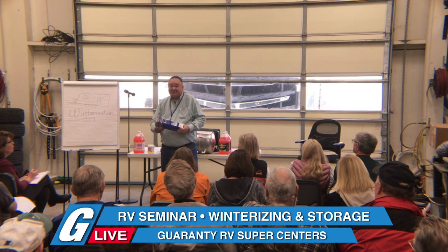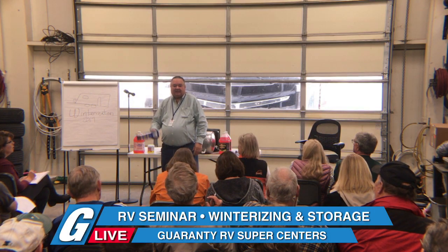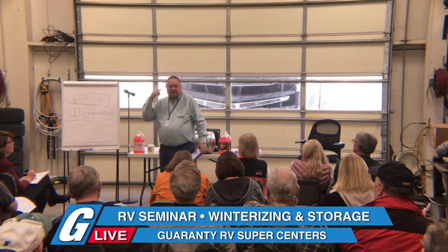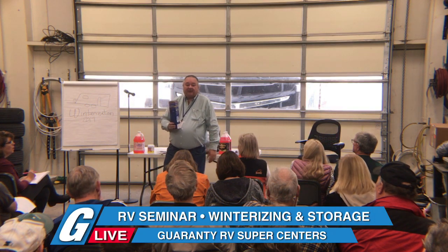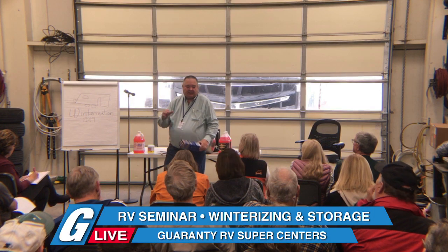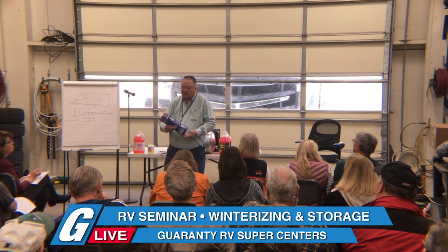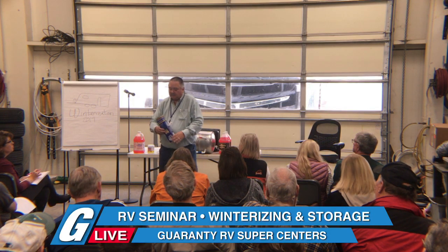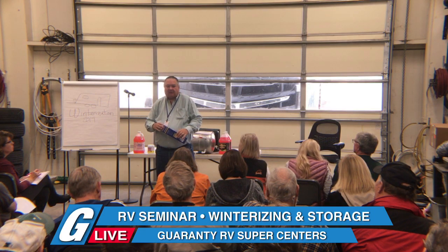Because all you're going to do is get sludge. So in the fall, you take this thing out, you pitch it, and then in the spring, when you get ready to go again, put a new filter in. So the best thing to do is either take a picture of the filter with your phone or save the carton that the filter came in, because it'll tell you which one it is. And there's a lot of different filters out there.